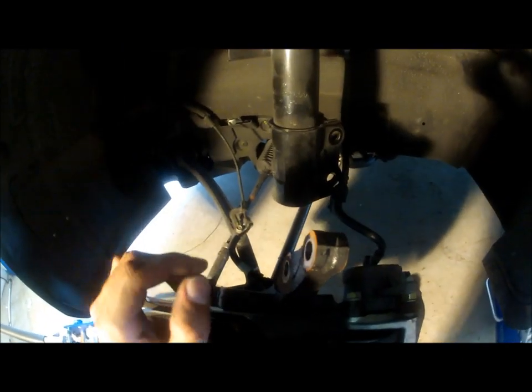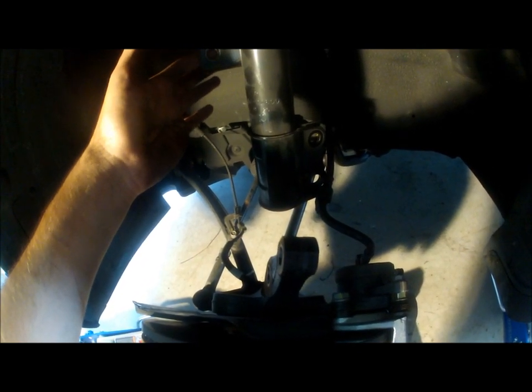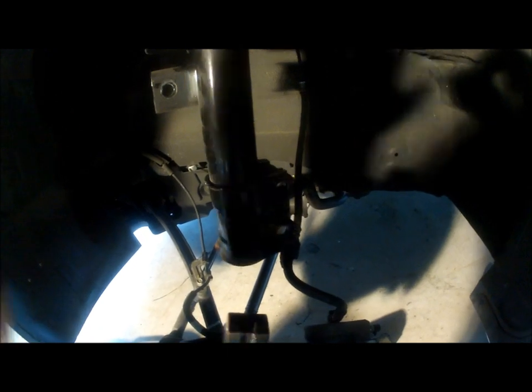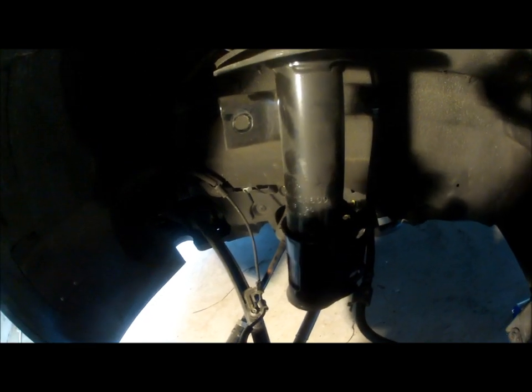If it doesn't slide out straight, you may end up breaking the ball joint. What happened here — even though it was a brand new model, it was basically stuck on the top mount. So we ended up removing the bolts that hold to the hub assembly, and then pushed back and forth and it popped out instantly. Fair warning: if that happens to you, just remove the two bolts and force it out. You're not going to break anything — you'll just end up breaking the OEM end link, which you're replacing anyway.